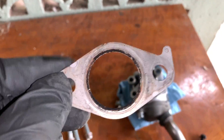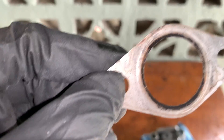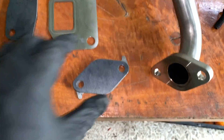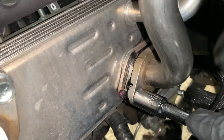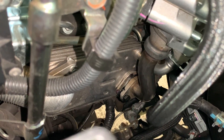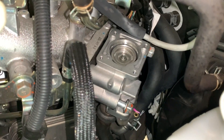You literally just need to take this gasket and replicate it without the hole in the middle, in a slightly thicker steel flange. This is the part I already have — you can fabricate it very easily. We place it in the middle and that blocks all the soot from going into the intake manifold. Now that the flange is already obstructing the passage of exhaust gas, I also applied some high-temperature RTV so it seals the boosted part of the EGR.